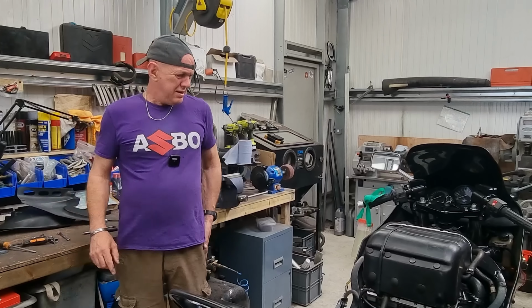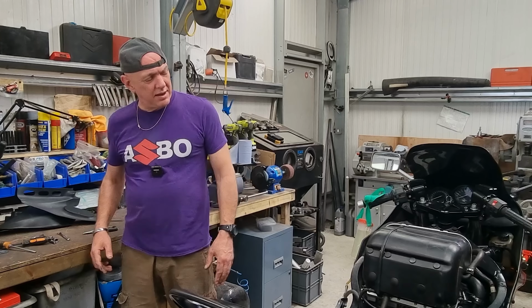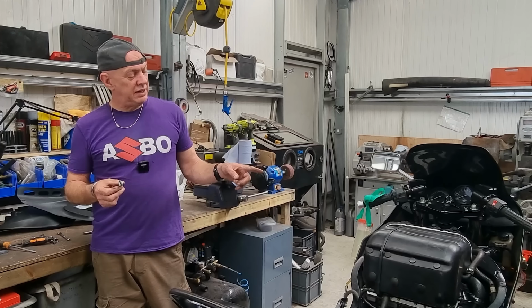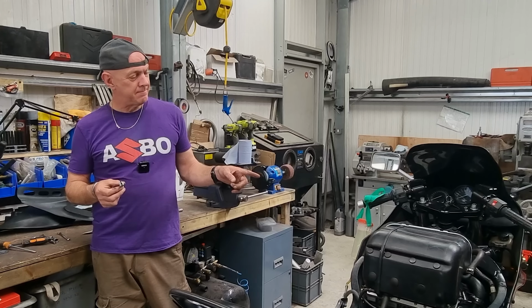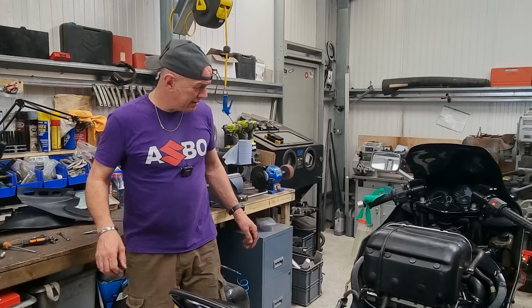So, main airbox is coming off, I think, just so I can get to stuff. It's only one cylinder. So in my head, I'm thinking it's either a knackered spark plug, which I don't believe because that was brand new. Could be a dodgy HT lead or cap. It could be that carb is just blocked up, so it's not getting any fuel. I need to check and see if the spark's all right on this, basically. So airbox is going. All right, what do I need for that? Well, I need you out of the way for a start.